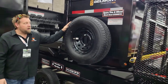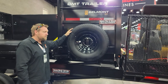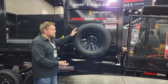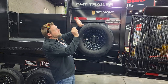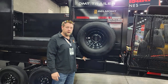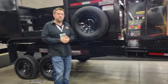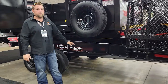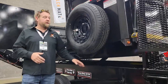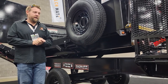We also offer the spare tire — full size, mounts right to the side of the trailer. A lot of guys ask why we put it on the outside. I've seen trailers put it underneath on the bottom of the bed, and you'd have to pick that thing up and hold it and put the bolts on — miserable. Plus, I don't want people underneath this trailer because of safety concerns. We don't want to put a human being between a bed up in the air and a frame, so we do not include an under-trailer tray.